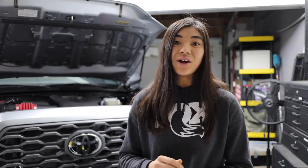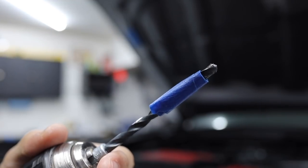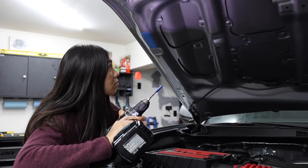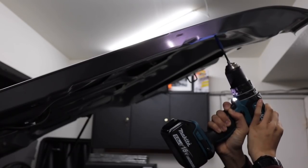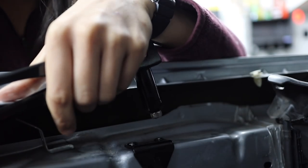I used a lot of blue masking tape to make my own drill stop. If I'm being honest, I don't think it actually made a difference — it more so just made me feel better. But overall, take caution and use a drill stop if you need to, because it's easier than you think to go too far. Other than that, the only real issue I had with installation was using my rivet gun. On the TacomaBeast website you have an option to add a rivet gun when you purchase these hood struts.